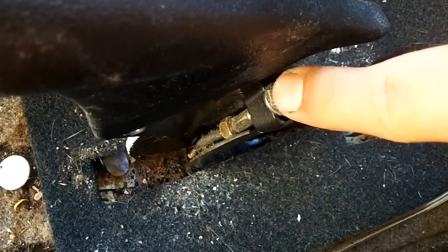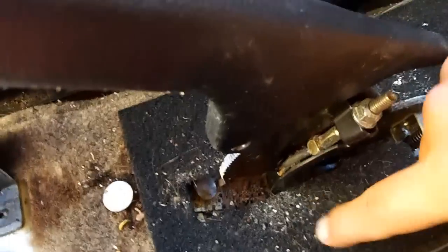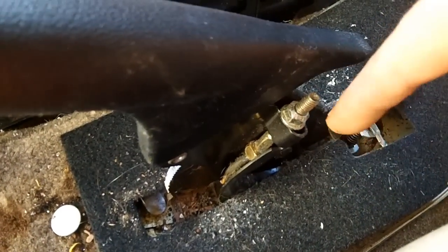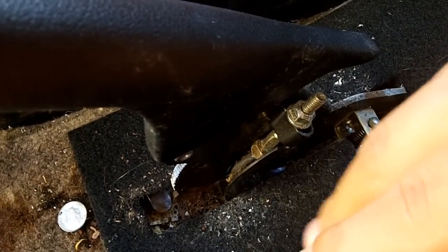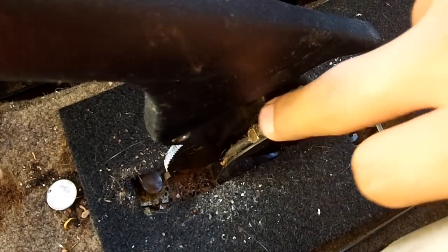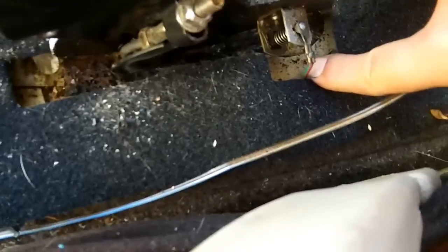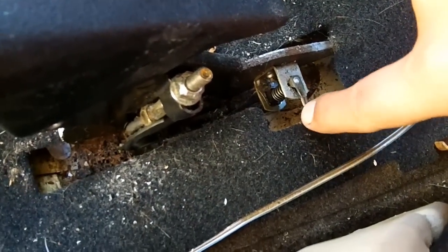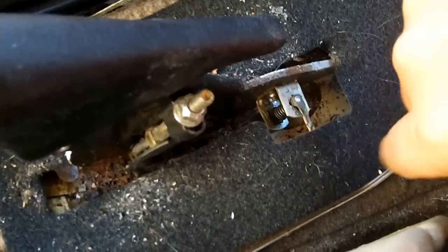Here is the emergency brake cable, which has a tendency to snap due to inactivity. This e-brake cable can snap anywhere from here all the way to the back of the car. It's probably going to snap on the actual physical cable that starts here and goes down and back. And here's the electrical sensor for the e-brake — so if your brake light is always on, your first step should be to check for a faulty sensor or corroded and oxidized wires.